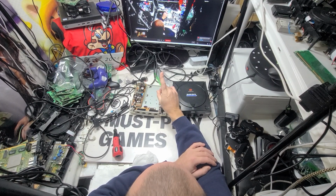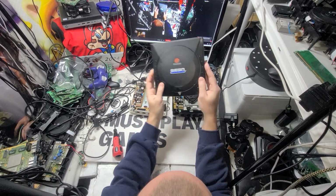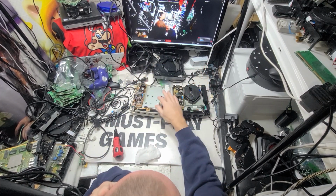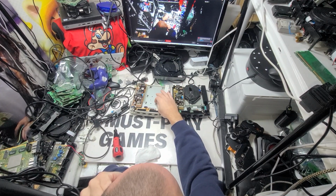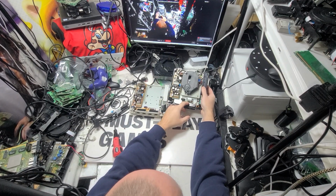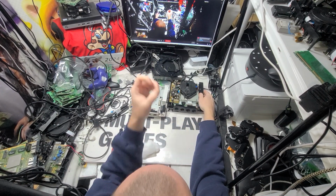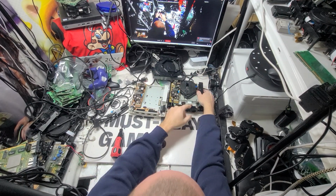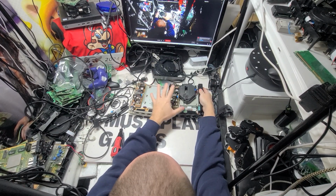This is one. One has a similar looking disk drive to the zero. But the model one is 3.3 volts, and it says it right on there. You could technically put a 5 volt supply from the zero model on there, and it'll go on, but it causes all kinds of issues. So on these 3.3s, model one is the most popular one.